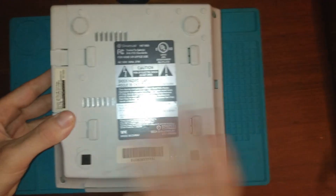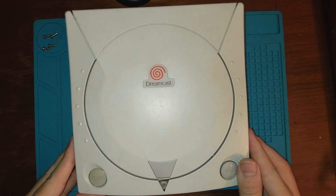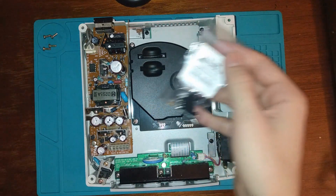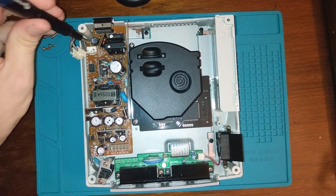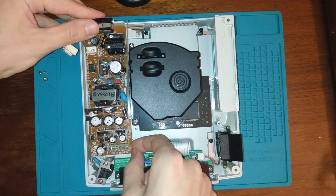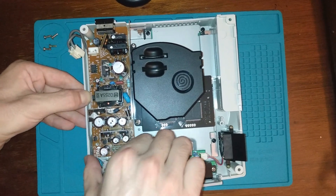Here's the GDMU. I have not taken it apart since 2021. Screws are out, let's take the lid off. This still has its original fuse and its original caps — I do have the replacement for that, but I'll save that for another time. Let's undo the power supply. There are two screws here. Always be careful when you're handling a power supply with exposed points and coils. There's a little latch here holding it in, so let's pull that back and then just wiggle it from the motherboard.